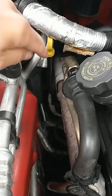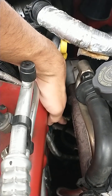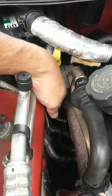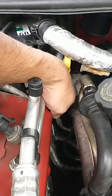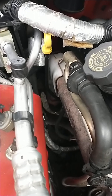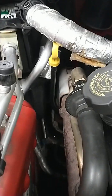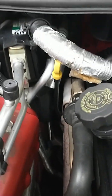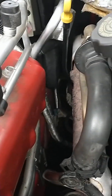As for the spark plugs, number 8 is hidden all the way back there, and same for number 6. Number 8 was the hardest, tremendously hard. If you have big forearms, forget about it. It's not going to work. You're going to have to go from the bottom, remove the starter, and go from underneath. But I was luckily able to wiggle my arm down there, and it worked. Although I did scrape my forearm, it's all red, and I even imprinted the exhaust manifold code on my skin. So it's definitely a pain in the behind for number 8.